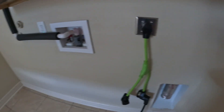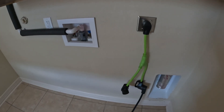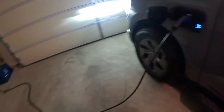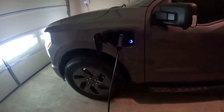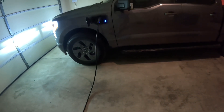And once the dryer was here, I could still have the dryer hooked up — it works pretty good and you can see it is charging the truck. Using the dryer outlet. You can also use the range — a stove top or electric oven, since that's also 220V, you can use that too. So you can charge on a dryer outlet and it gives you four times faster speed. Good test — thanks everyone, see you on the next one!